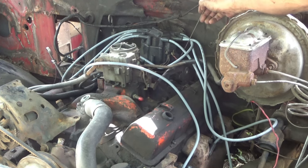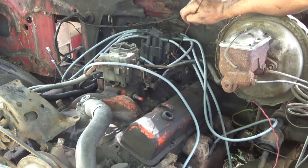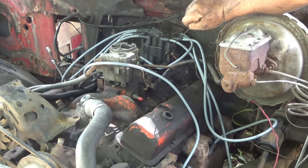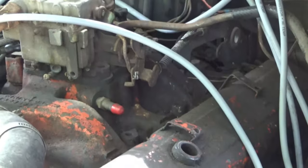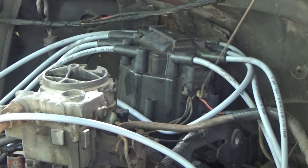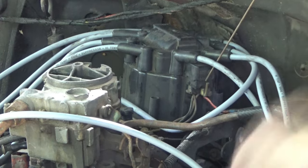Here's the other important wire — make sure you plug the cap into the base. And then this is the other hot wire that hooks up to the one that says BAT. One says TAC, one says BAT, which is battery. I don't know why it says battery, because it should say ignition switch or something. But this one needs to come on whenever the switch is in the on position — the run position.